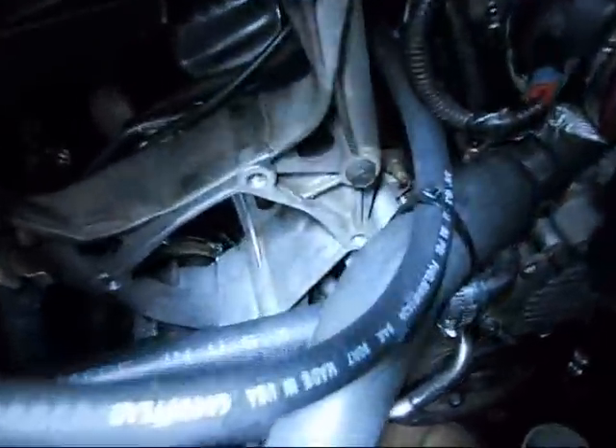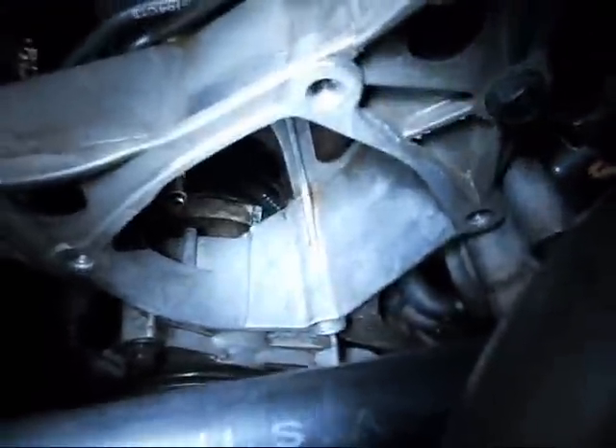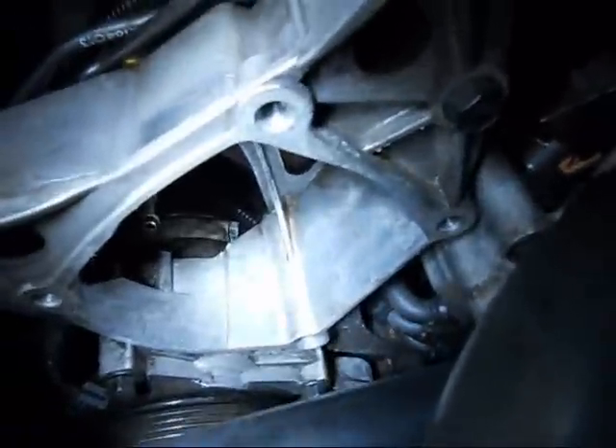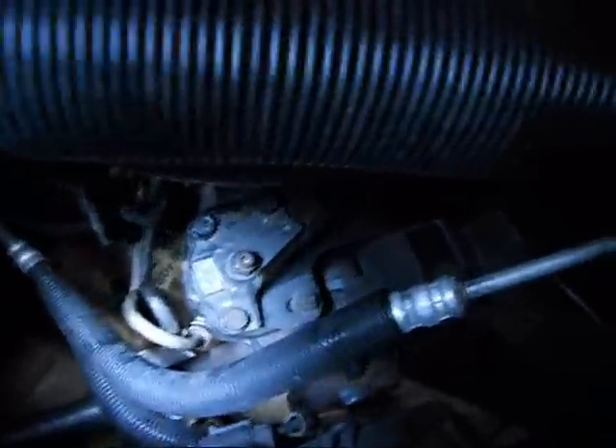I had a leaky pump, so I took it out and it's being sent to Lee Engineering for a rebuild. I don't know how much it's going to cost — probably a lot — but it's a lot better than those parts store pumps. With a parts store pump for an LT1, on a Camaro or similar, they have a lot of play in the shaft — it wiggles in and out way too much and they whine. That means the plate is worn in the pump.